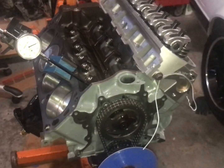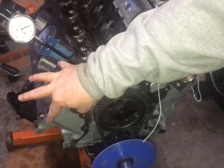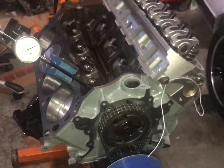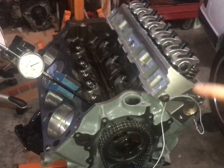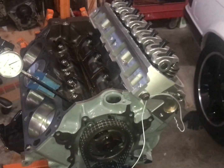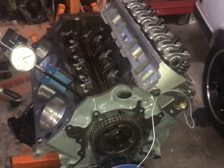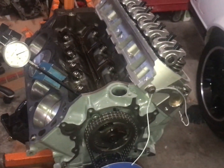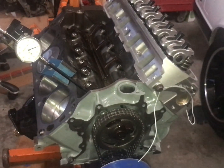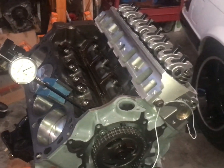The other thing we'll do — I know we already did the clay method, which you may have already seen, and you can see we've got a ton of valve clearance; I think I only showed it on the exhaust side. We're going to put the cylinder head back on and then use the degree wheel to figure out with a gauge exactly how much piston-to-valve clearance we've got on both the intake and the exhaust. But I feel pretty good that when we button this engine up, all of the valve opening and closing events are happening as intended.